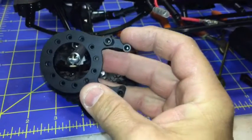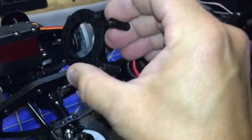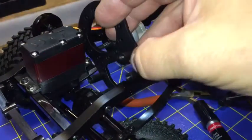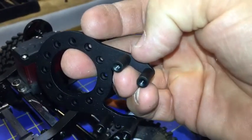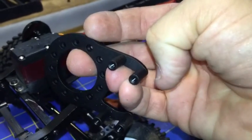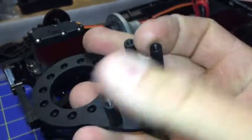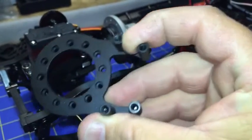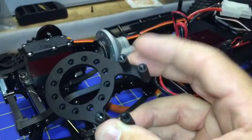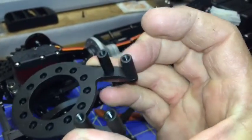Before I do that I should explain — this is the tab you have to cut right here, the outermost top tab. When you get it in place you can swing it down, and this is the only one that hits. You have to trim right about where my thumb is — right about there, get rid of that. You have three out of four left. Searching around, I've seen people say unless you're using a stupid amount of torque the truck will be fine with just three, and I'm not using a stupid amount of torque. So I'm going to take the screw out and give this a little haircut.